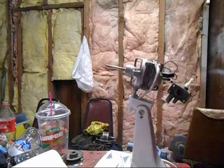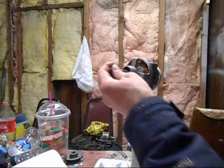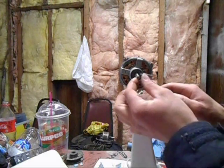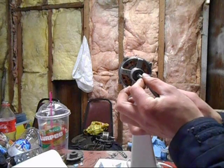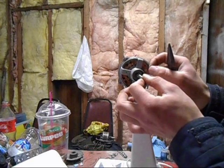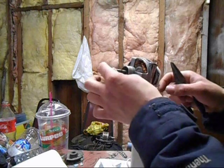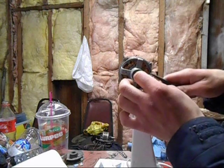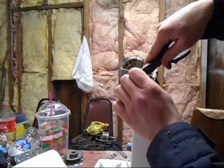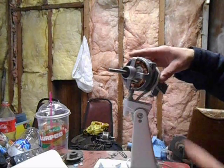I think on this fan the rotor comes out the front of the stator. Remove this thing — some fans just have a little piece of tubing through a little hole in the rotor. It's not a solid piece, just a flat piece rolled into a tube type of thing. You'll know what I mean when you see your fan. Just pop it out and pop it back in, but this one's slightly tougher. That was relatively easy — now I'm going to clean the bugger out of that.